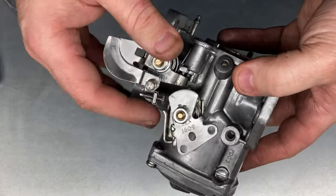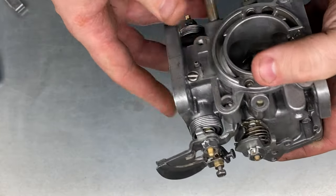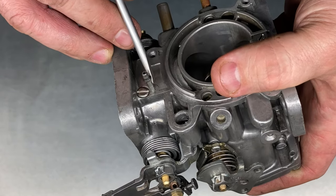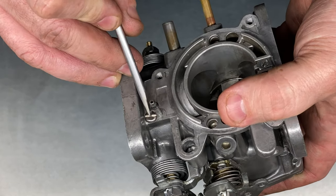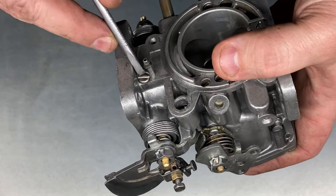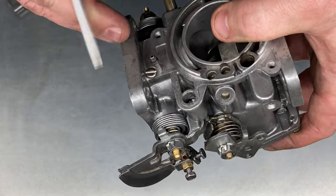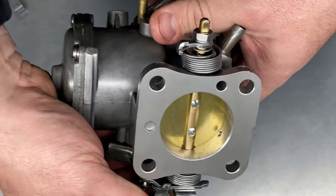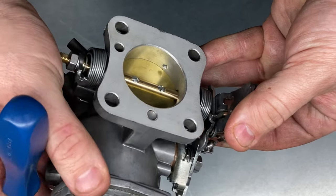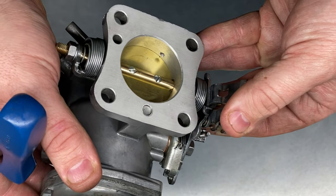While I'm here, I'll give you a quick once over of some of the modifications that you get on an AC Dodd fast road SU. One of the things done on these is there's a screw there and the vacuum port has been relocated — that is to change this carburettor from what they call manifold vacuum to ported vacuum, which basically reduces the ignition vacuum advance at idle, giving much lower emissions and also a smoother idle. When you open the throttle, that butterfly uncovers the vacuum hole so that when you're driving you get vacuum advance, which gives you nice efficient running at part throttle.